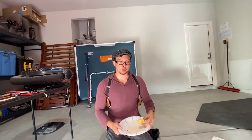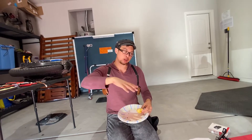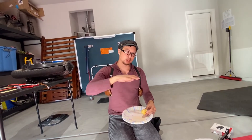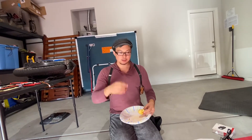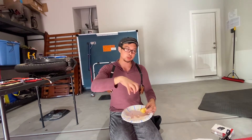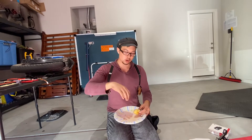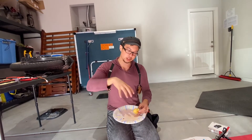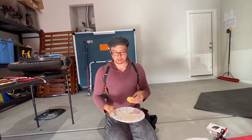If you have the time, charging at 1 amp is a lot more beneficial. I explain it by saying it's like pouring water into a sponge. If you dump it fast onto the sponge, it won't be able to absorb — the surface gets wet, and that's considered fully charged even though the inside of the sponge isn't really wet. But if you trickle water onto a sponge, it spreads a lot more evenly throughout. That's the same thing as the battery.